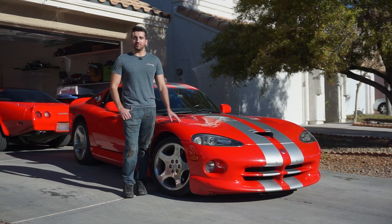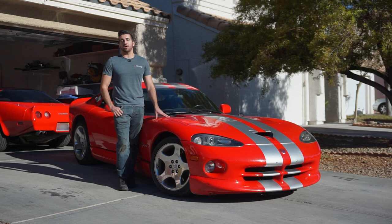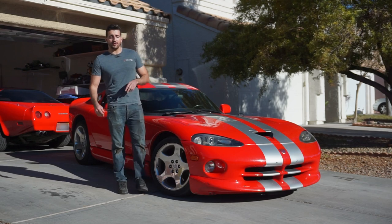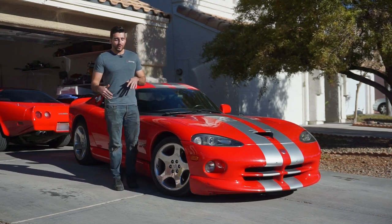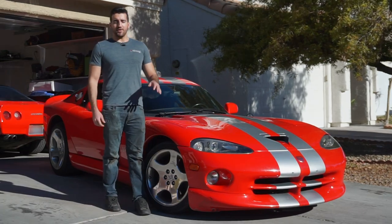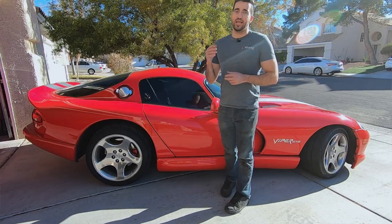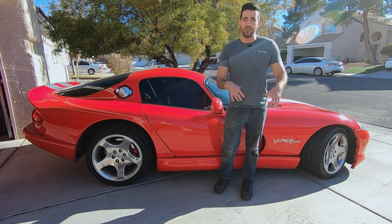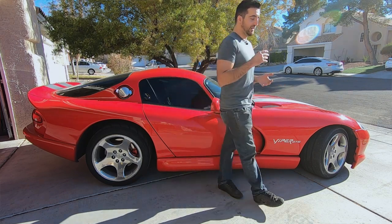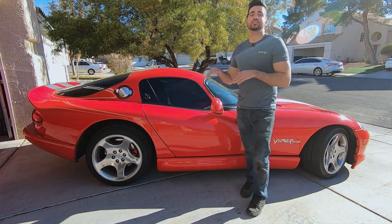Now I showed you in a previous video that the radiator fans are screwed up. I mean, not screwed up, I really screwed them up because I'm an idiot. I wired them temporarily. I got new fans for this car because this car majorly overheats, and I was very sick and tired of the overheating. So I got new fans for this thing. It's a shroud with two fans on it. And I didn't have the right waterproof connectors. I didn't have the right wiring. So I just threw it in and said, oh, I'll just fix all this stuff later on.